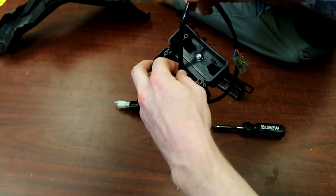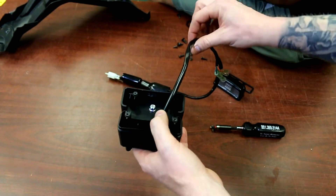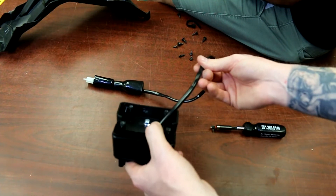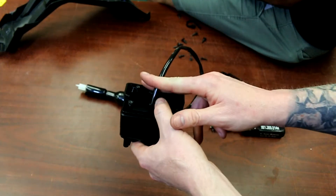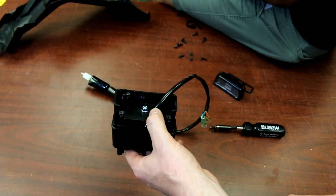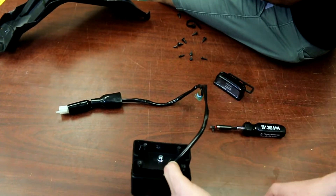What you can do is just cut the wires at a reasonable place when it is mounted inside the fender bracket, so that you still have some slack for running the taillight. You won't need much because when you do the fender illuminator it is right underneath the seat. We found it's probably easiest to just cut this, strip the wires, and put a pin on it to connect to whatever taillight or license plate cover with LED you have.